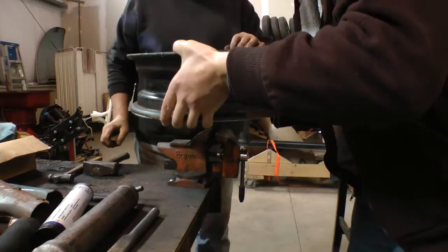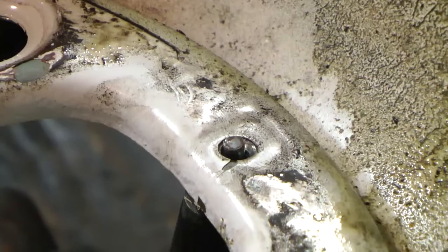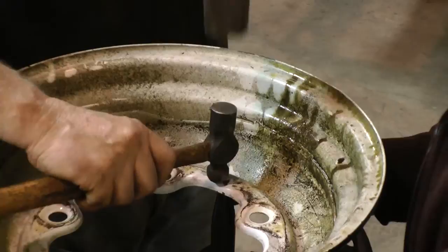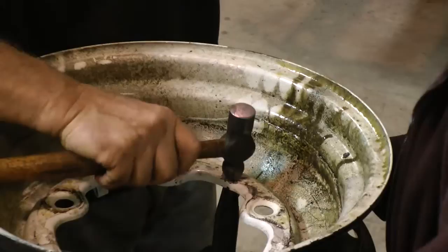As you can see, we're going to place the rim on top of the peening tool. The clip sits on the flat part of that tool, and the top of the tool is beveled for this little pin to hold in there. Just wiggle it around and make sure you're in that little hole at the top of the tool so the head of it sits properly. Then just get a hammer — a bigger hammer works well — and start banging away at it. The bottom of that pin will start to flatten out, smush, and hold itself in that hole.